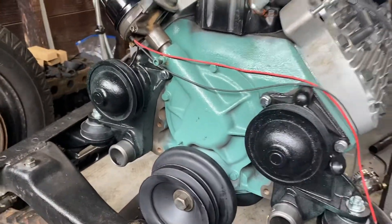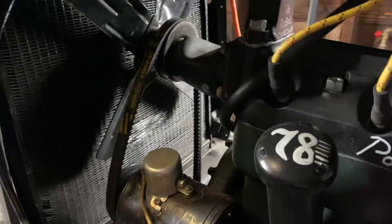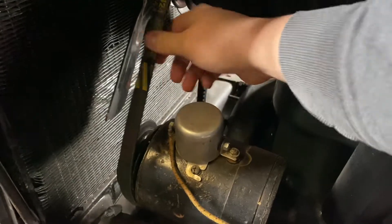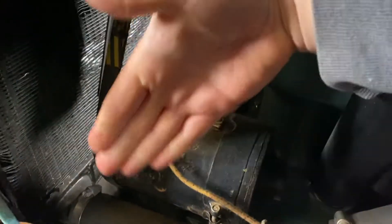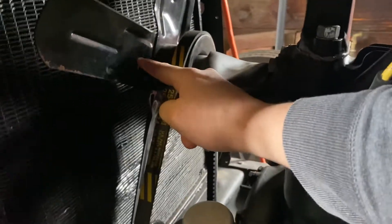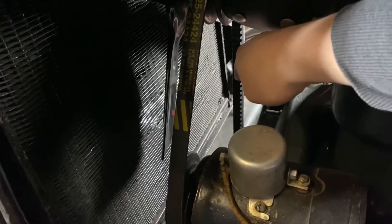I'll show you on this other car right here — you can see the belt right there, that black and yellow thing. I checked before the video and this belt's a little loose, so this belt could slip on the pulley of the generator, and it could actually come flying off. So what I have to do is loosen this up and pull it this way toward me, and that will tighten the belt. That's important because not only does this recharge the battery, but this right here is your fan — this cools the engine off while it's running. If the belt is slipping, the fan's not going to be spinning up to speed and the engine could overheat.